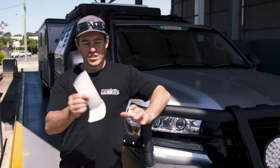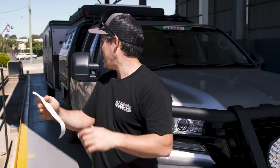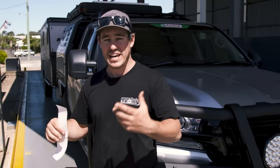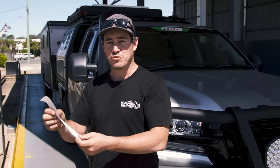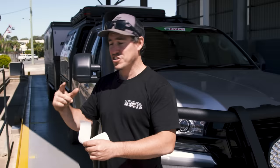Now this is quite interesting. I knew what the caravan weighed beforehand and what the vehicle weighed, but it's good to see on this weighbridge — it can actually split up the weight. With the caravan hooked up to the vehicle, it's added a tow ball weight of 260 kilos onto my vehicle. So if you're worried about your vehicle being overweight, hooking up a big caravan adds a fair amount of weight to the vehicle's GVM. All up we're on 6.84 tonne — that's quite a heavy load.